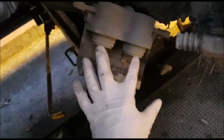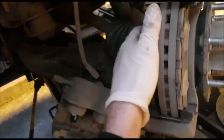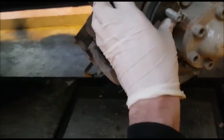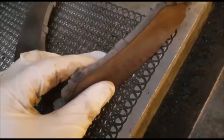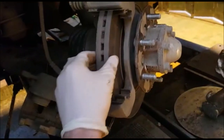Next we're going to try and get that piston in — I'm going to order a new caliper. If that's easy then we can wait for the caliper before we do any more. Whip the two pads out. As you can see they're really low, nothing on them at all. The other side has gone metal-to-metal so we'll be replacing both discs as well because it's badly scored the other side.